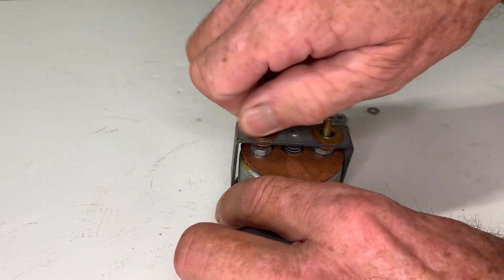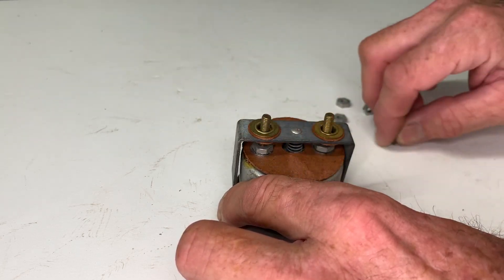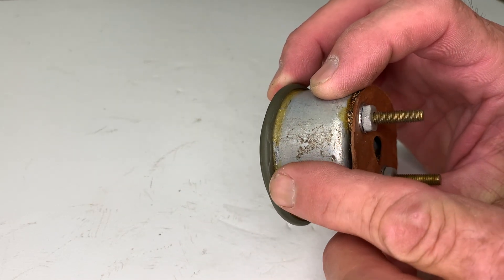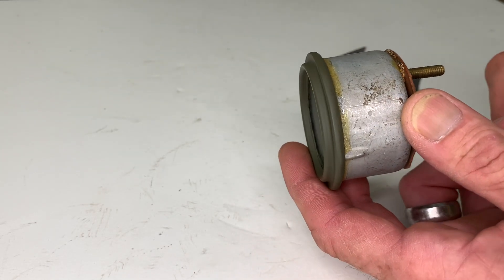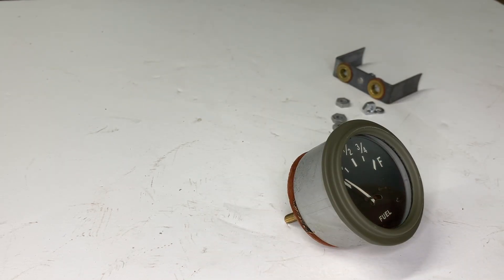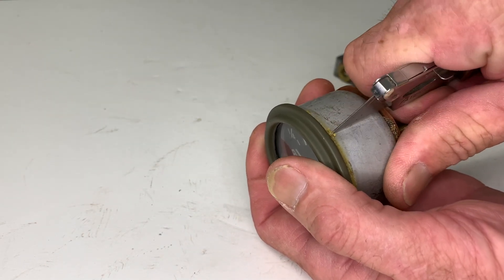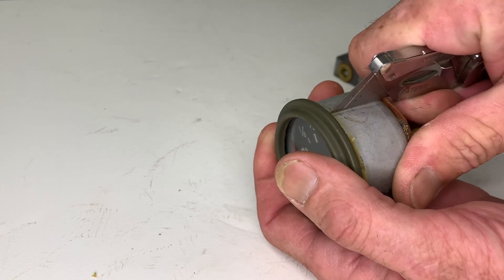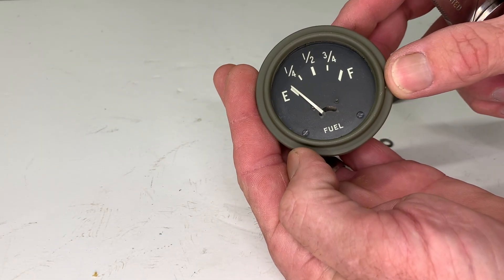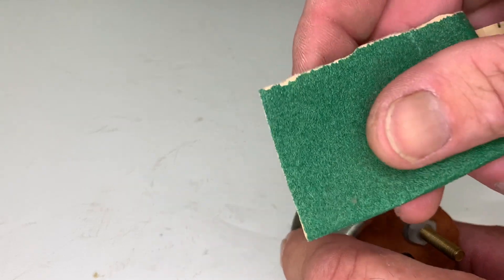I've installed a lock washer and then the second nut, and that's where our wire is going to be installed. I want to show you how this goes very clearly here on the workbench, because once we get underneath the cowl of the Jeep it's going to be a little bit more difficult to see. One of the things I'll also be repeating in this video is the importance of the proper grounding of the entire system for it to work. The housing itself also receives a ground from the two points on the back side of the bracket that goes on the inside or underneath side of the dash.